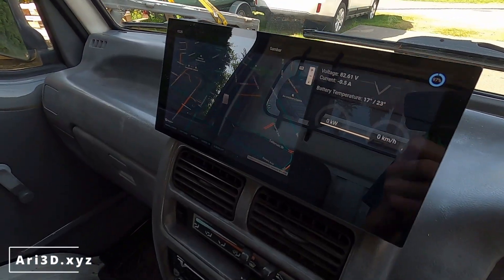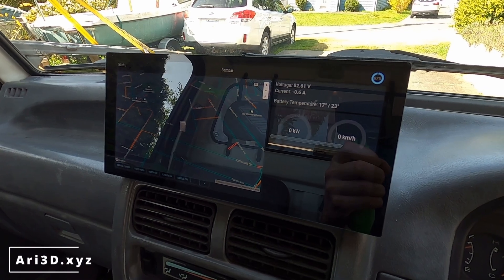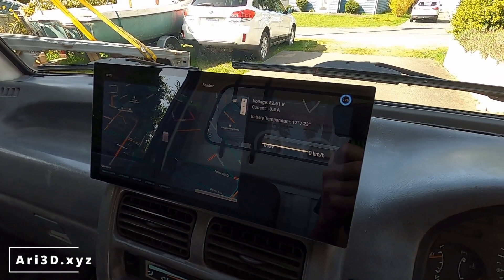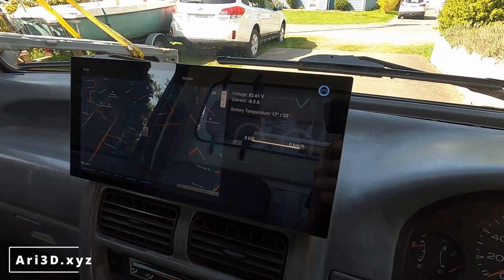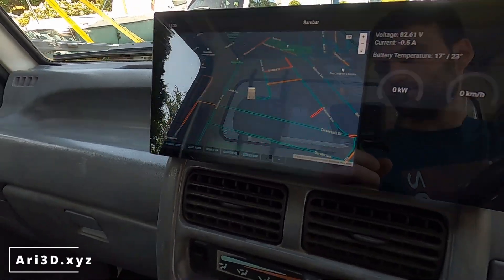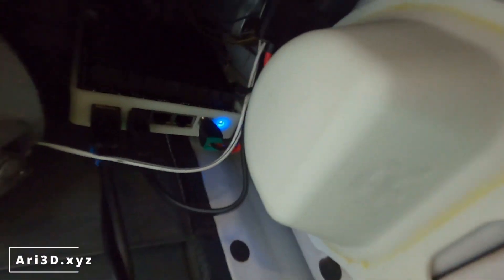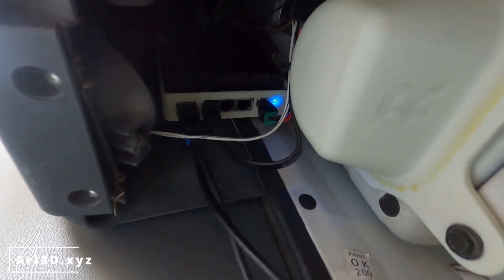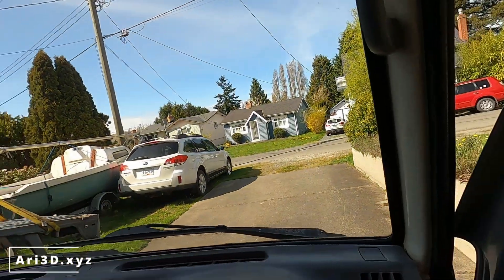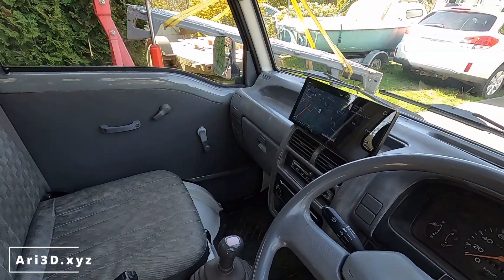Inside the cab, on this custom touchscreen it shows a map of the truck and where you are. You get a little chart with the speed you're moving, power consumed, and some basic stats from the BMS. Lots more is available — it logs it all internally in a database, and there's a whole bunch more graphs that you can go back in time and analyze the performance. And then underneath the dashboard right above there — a little hard to see — is the computer. That's doing all the data collection from all the devices in the electronics box as well as a GPS on the roof, and logging it all on board.